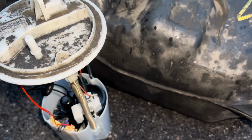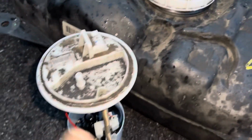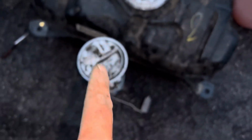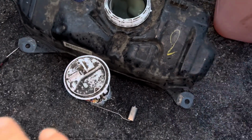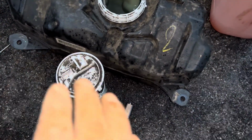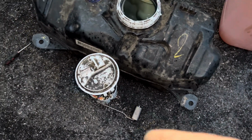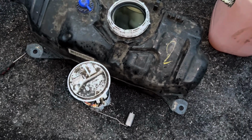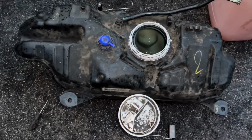So all I had to do was, on the side of the road, take the back seat off, get this out, shut a submersible pump down there, drain all the fuel out of the submersible pump, clean that, put it all back in, add fresh fuel into the car, the correct fuel, change the fuel filter, and just run the car for a few seconds, and it ran perfectly fine. Now, because it was a typically old car, it worked. With the newer cars, they tend not to take a lot of the crap from you. It is a similar method, you just siphon the old fuel out, as you can see, guys.